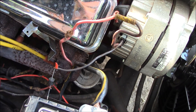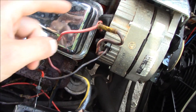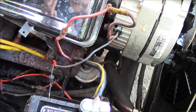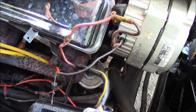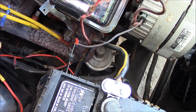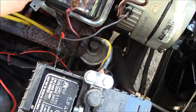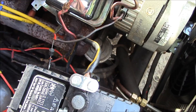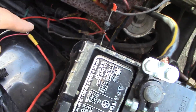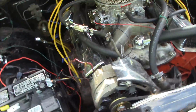Now that it's in — it's not soldered yet, I just have it twisted around the leads, as I want to solder all of these connections that were done by other people with crimps. The rectifier diode — some of them are directional. On this one, the stripe goes towards the alternator, and I put it in my keyed ignition source wire that leads to the alternator. This is the line that's used as the keyed ignition source.